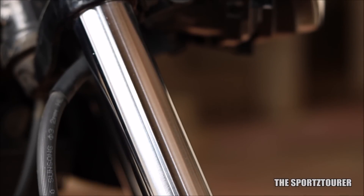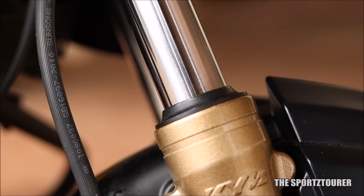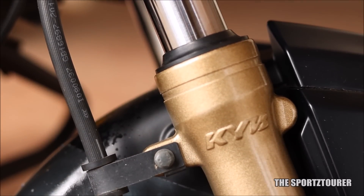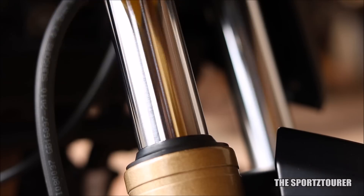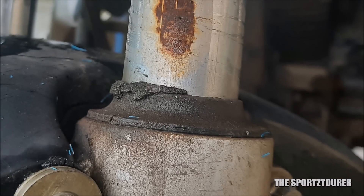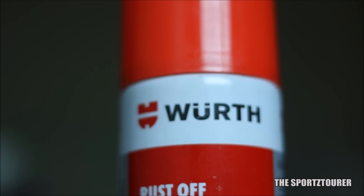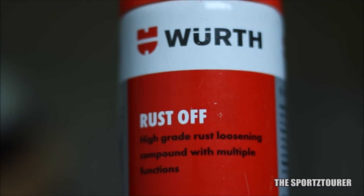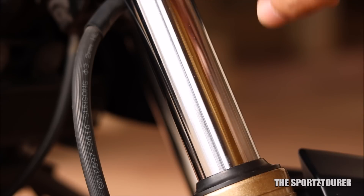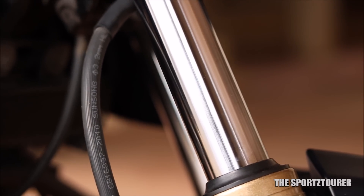Coming up from the brakes, we have the suspension. Before going for the wash, I had cleaned them, as the dirt deposit on the fork tube will put extra load on the dust seal while the suspension is in action. If you have got rust spots on the suspension tube, I would suggest going with something like Rust Off and a mild abrasive for cleaning the rust from the area of suspension action. This should also be a good time to inspect the suspension movement for any kind of leaks or a busted oil seal.